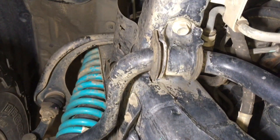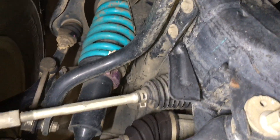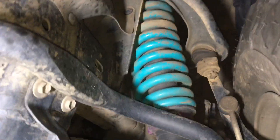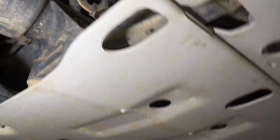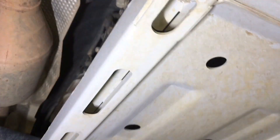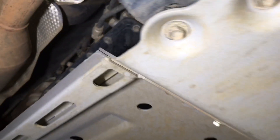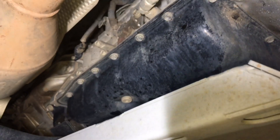It's obviously got Dobinson's monotubes in the front — they look like the earlier versions, that's all good. No leaks, no remote reservoirs. In my opinion you don't really need those, but each to their own. It's got the ARB bash plates up the front. They're a bit thin — the 3mm ones — but this is not about picking on ARB bash plates; we prefer the 4mm. Once this gets used off-road they'll probably get bent up a bit and get hard to remove. I'm not a massive fan of that automatic transmission guard blocking airflow to the automatic transmission pan.